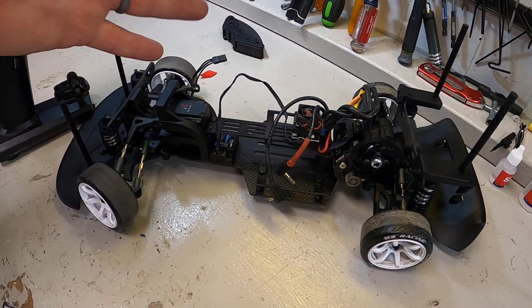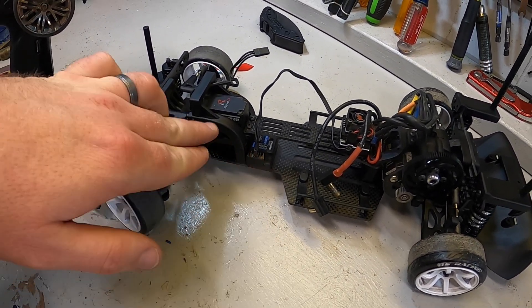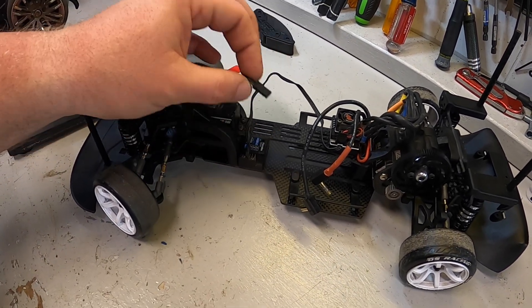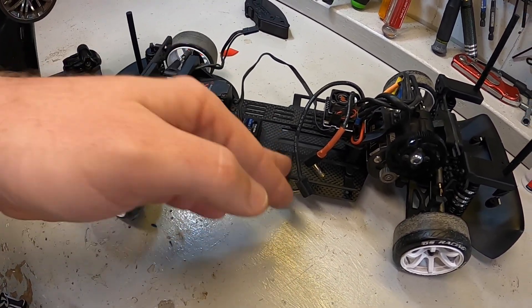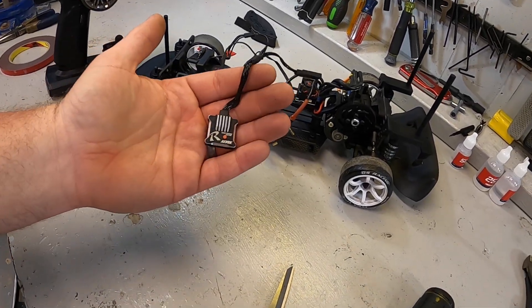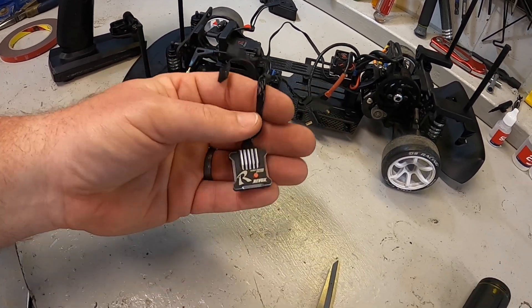Based on the packaging I'm working with right now, I'm going to have the receiver right here behind the steering servo. That way, with the super short servo wire, I'll be able to reach what I need to. Plus leaving room for a gyro and we have everything else here. Speaking of which, it is onto one of the most important parts of your drift electronics — which is the gyro itself.